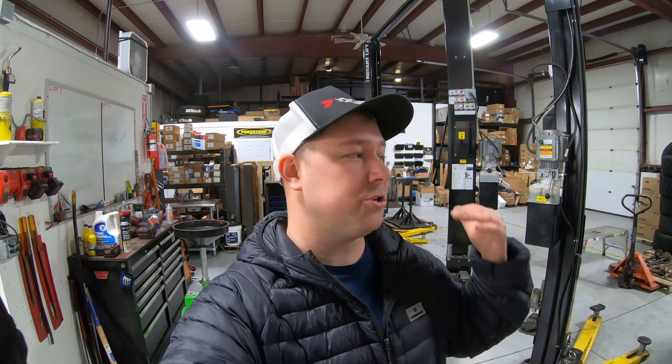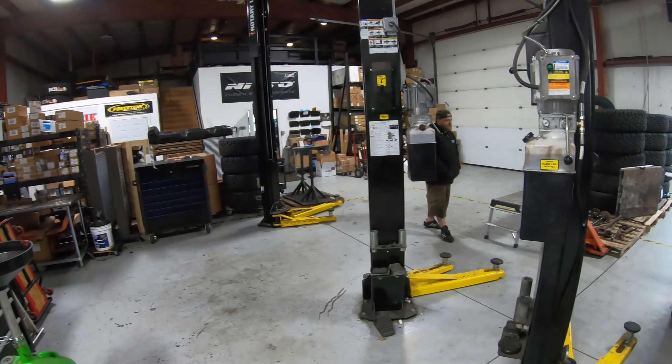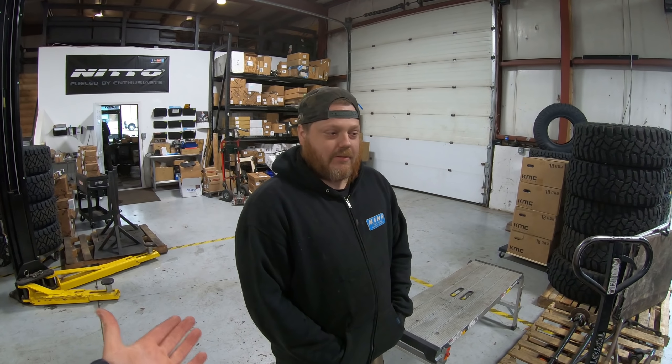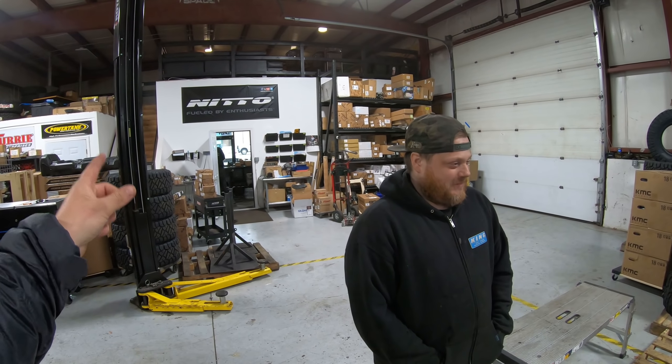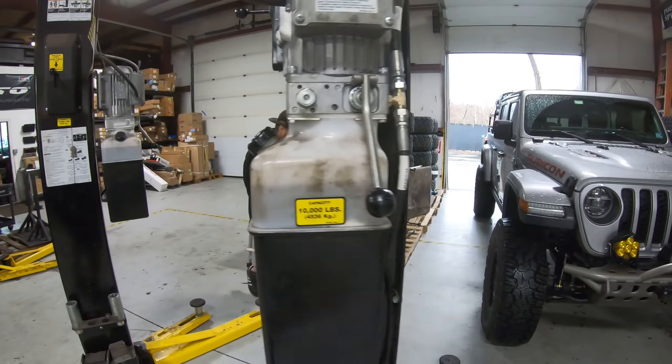In this video we're gonna talk about how to upgrade your axles and show you guys what we're doing on the Gladiator to handle 37s or bigger. Scotty's JK has 44s with 37s and loves the setup. Jillian has 44s with 39s - it's a very good setup. Before I went to 40s and one-tons I was running 37s on a Pro Rock 44 front and the Rubicon 44 rear with RCVs up front and chromoly shafts in the rear. It was a great setup - the Jeep is still lightweight, still nimble, and you can beat on it without worrying about breaking things.